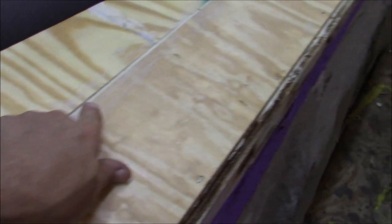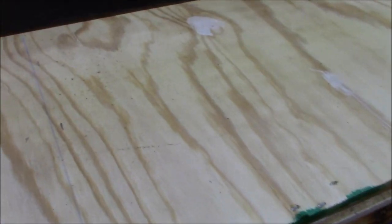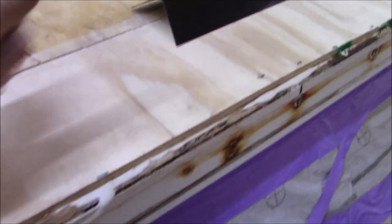Then we also glued them together. So I want to make sure everything was as tight as I could make it. Obviously, all the decking is all glued down. We staple everything. Those staples are going to hold real well. These are designed for sheathing. So typically, you go to tear this apart, you'll rip the plywood apart before you're going to get those staples out. So here's the next one. So one there, skip. This one. This little piece is on that other side. And then you got this one. And like I said, we glued everything all together.